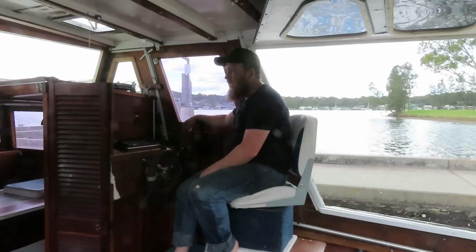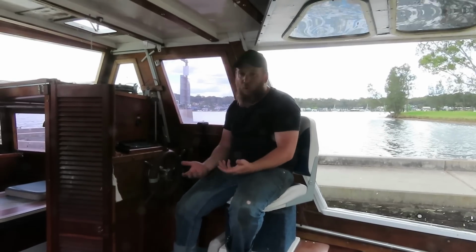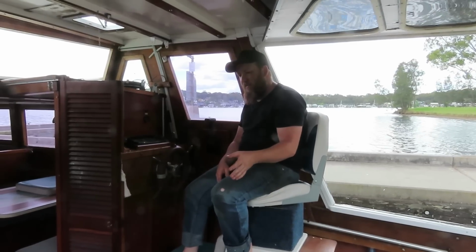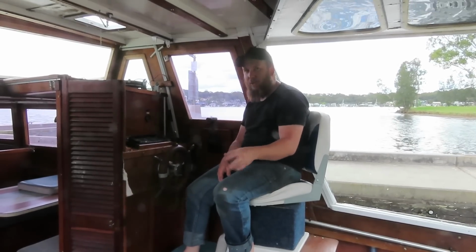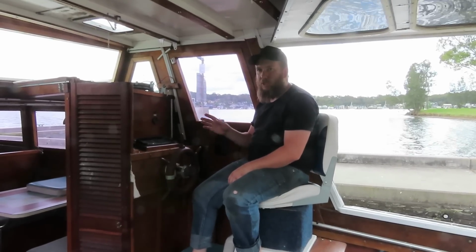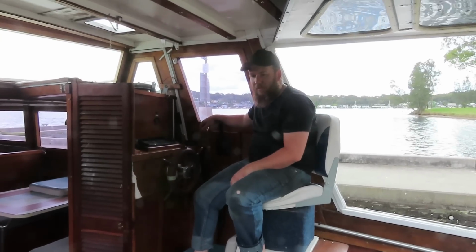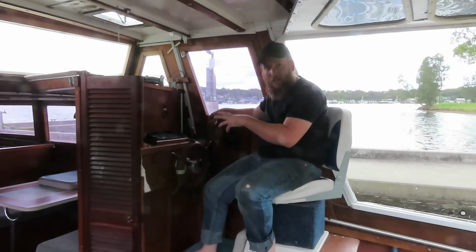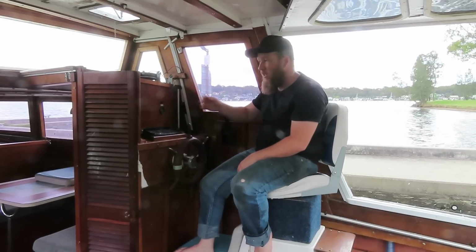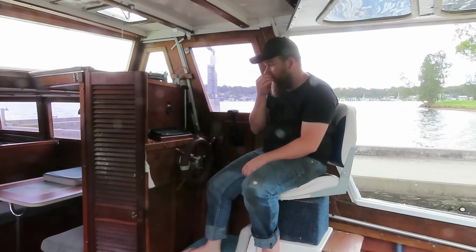Righto, so, I mean, it wasn't a waste of time. Maybe one of those might have worked better, maybe they didn't. I will say that the silver 20-inch pitch prop seemed to cruise a lot nicer. It was a lot lower RPM to get 6.5 knots, but I was using a fair bit of throttle. Not what we're going to want for running up the coast, because I want the ability to get it to 8, 8.5, 9 if I have to. But it might be something to keep in mind for cruising around when I get it up to Port Stephens.